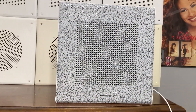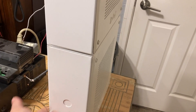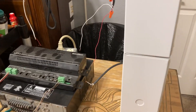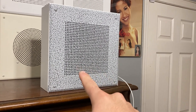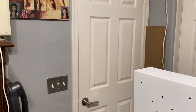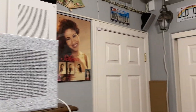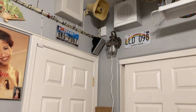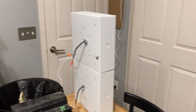For this video I'm just going to use three ceiling speakers because they're easily accessible. Let's say this one is tapped at one watt, this one at five watts, and maybe two watts — you have to tap your transformers accordingly. What I prefer and how I do it on my system: I usually tap all speakers at five watts. Every one of my speakers is either four or five watts, with the exception of horns — I have those tapped at 7.5 watts, which is the sweet spot for proper sound balance without one speaker drowning out the rest.